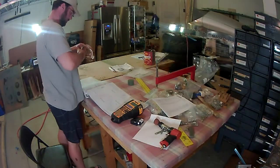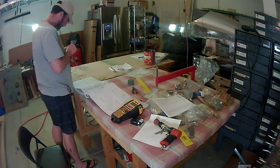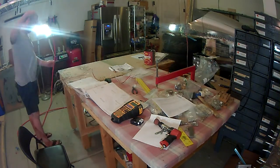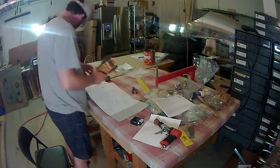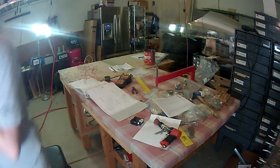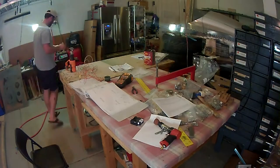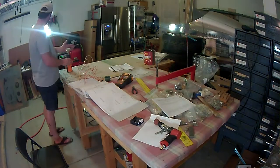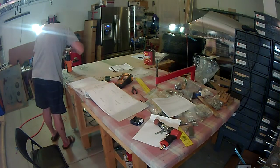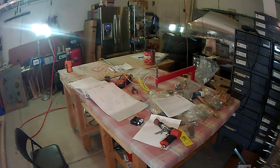Welcome back. In this video I'm going to be starting to work on the electrical wiring for the right wing. The right wing wiring includes the nav/ID lights, the landing and taxi lights, and also the autopilot servo for the ailerons. It has two separate wiring harnesses that both terminate at the root of the wing, at the bracket installed on the number one rib where both terminal blocks for these wire bundles are housed.